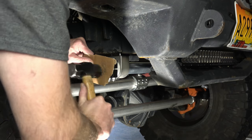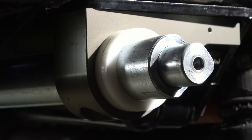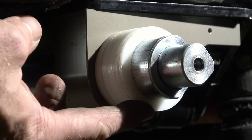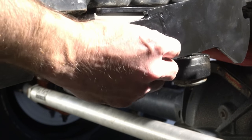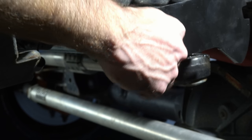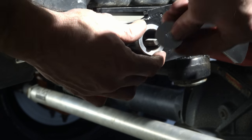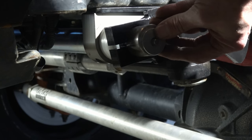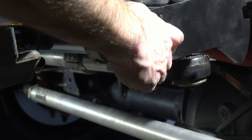What I'm doing here is just using a piece of cardboard to protect the arm and a hammer to tap it towards the driver's side so that it seats fully against that aluminum bushing mount — that'll give me the entire torsion arm length on the driver's side, which is what I'm working on next. Now I'm adding in the rest of my spacers. I end up with two of the skinnier ones and two of the fatter ones, and like I said, that worked out in my test fit. Same installation tool, except you insert the stud, then add in this little standoff tube, then back to the heavy washer and that little nut. We're going to press on the inner arm all the way onto the larger diameter torsion bar.